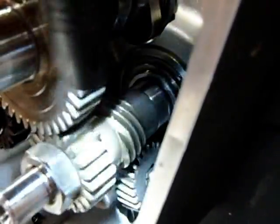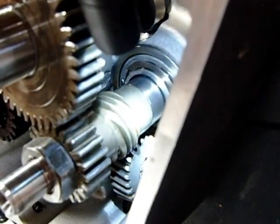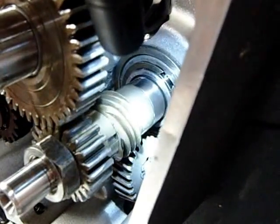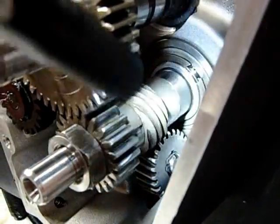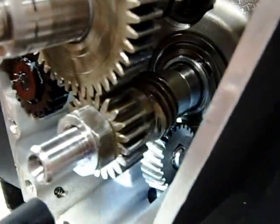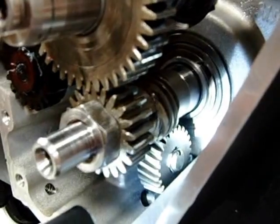As we were putting this on here, this gear back here that have the light on is backwards. It's flipped. So we've got to start all over. We're going to take this apart. We're going to get this pinion shaft nut back off and then get that gear flipped. And that is, Casey, that's just a great observation that you had there.